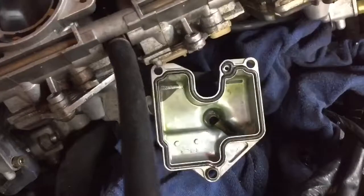If I can blow through it when I push it up and it shuts off, it's working perfectly. If it wasn't coming through, there'd be a limited amount of fuel, or when you shut it off it wouldn't shut off and it would just flood the carburetor. So that's my top tip - I do it on the other bikes as well.